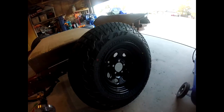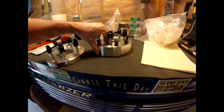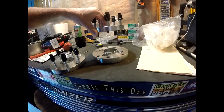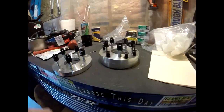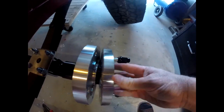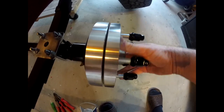To run the five lug wheel I need a five lug adapter, since this is a four lug trailer. The problem I ran into — here's the adapter — it's a two piece adapter. You've got to make it two piece because you're going from four lug to five lug, so you can't drill five holes into a four lug spacer and have it be centered. The first piece is the four lug adapter, the second piece is five lug — it bolts together and your wheel goes here, looks like about an inch and three quarters. The problem is when you go to mate the two together, the lug nuts and the studs do not allow this to mate perfectly up to the mounting surface, which presents a problem — it's got to be perfect.